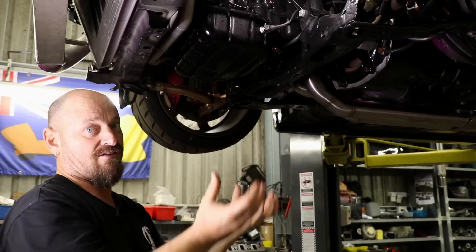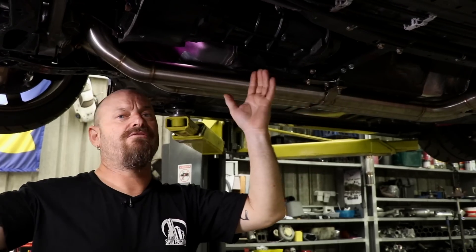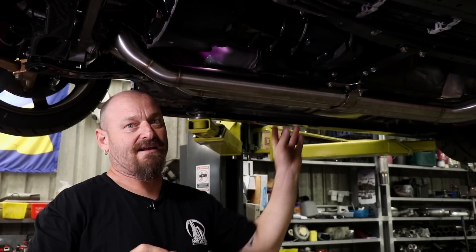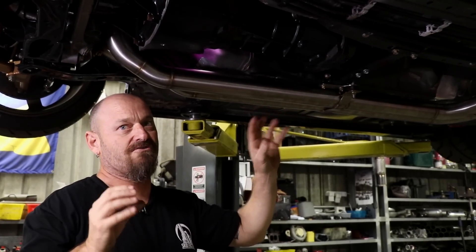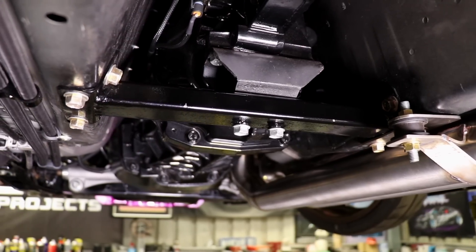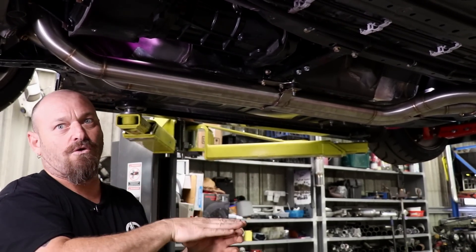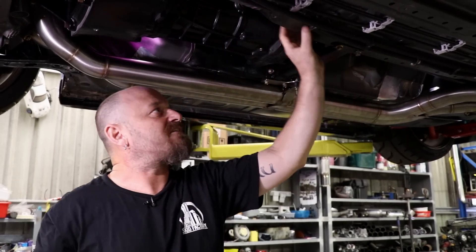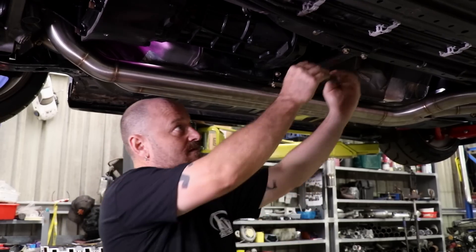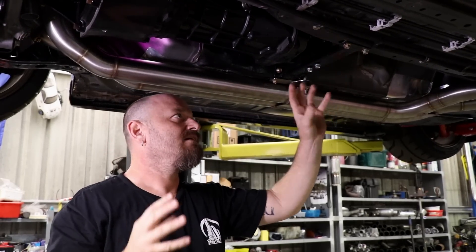On the transmission mount: on any engine conversion in one of these 86s, that's where your problems are going to be. There's actually a huge brace inside the tunnel that houses the original transmission mount, but everything's a lot further forward so you can't use it — and you can't actually fit the transmission in the tunnel once it's all pushed back anyway. So that all has to be cut out; it's got a lot of spot welds and it's a very tedious job. To replace it I've made a simple crossmember, but the devil's in the details — I had to remove a section of floor to reveal the inside of the tunnel, insert a plate with captive nuts down inside and weld it all together as neatly as OEM as possible.